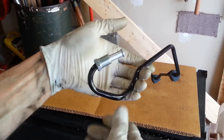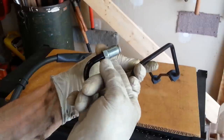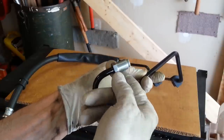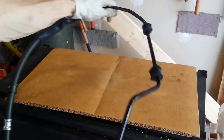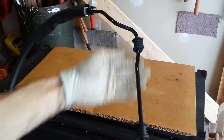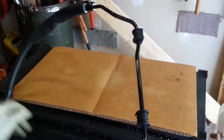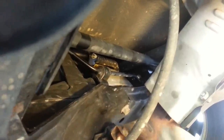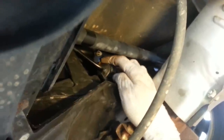Looking back on the new part, this is the connection we're trying to get loose and it's a 14mm - it's a pretty good size, so we're going to have to come back to that with a different approach. Let's move on to these bushings. There's a strap around each one of these with one bolt holding them on, and that's around the back of the rack. Let's go take those off next. Here's that one bushing with a little metal strap around it - there's a 10mm bolt holding that metal strap on the bushing.